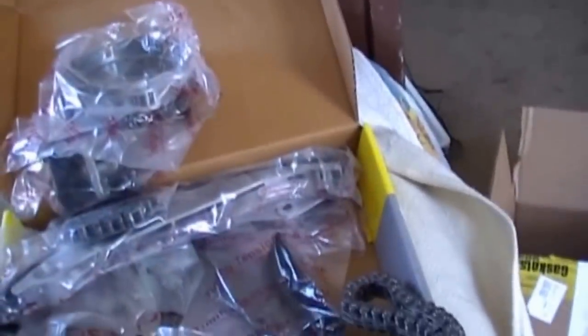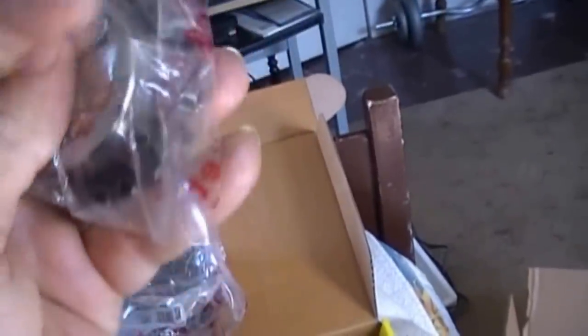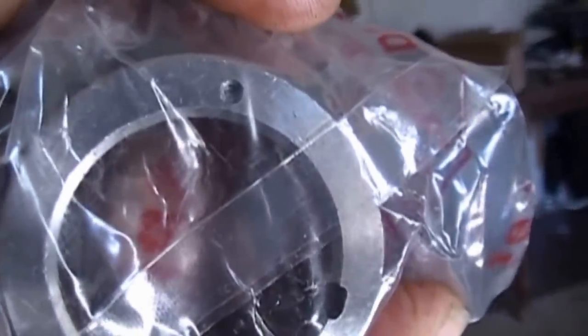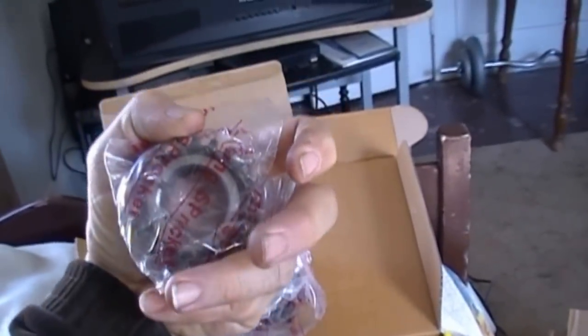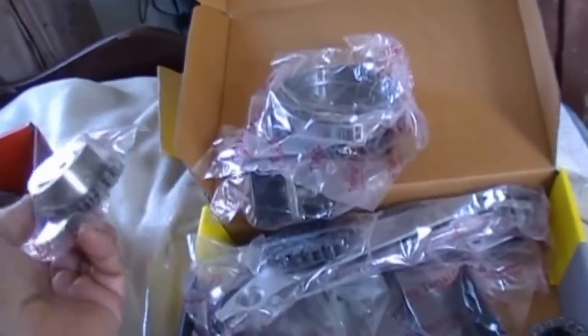With the crank gear, I'm going to have a problem getting the old one off. It doesn't have a marked timing mark for some reason from the factory. But if you look very carefully, right there - there is the timing mark. Let me get a better picture. There is the timing mark. The one on my car does not have a mark on the timing gear, so I'm going to have to somehow get that gear off today.